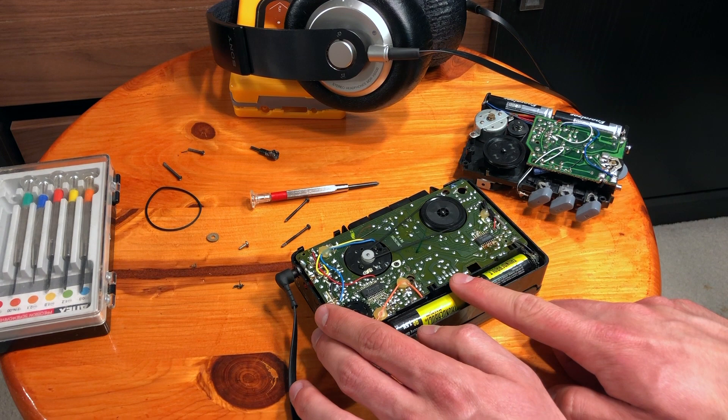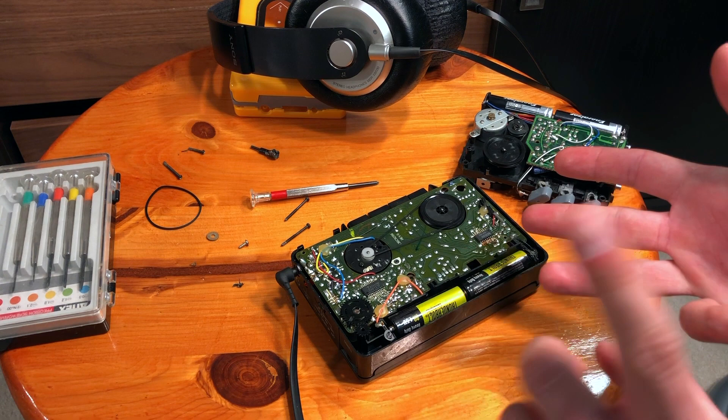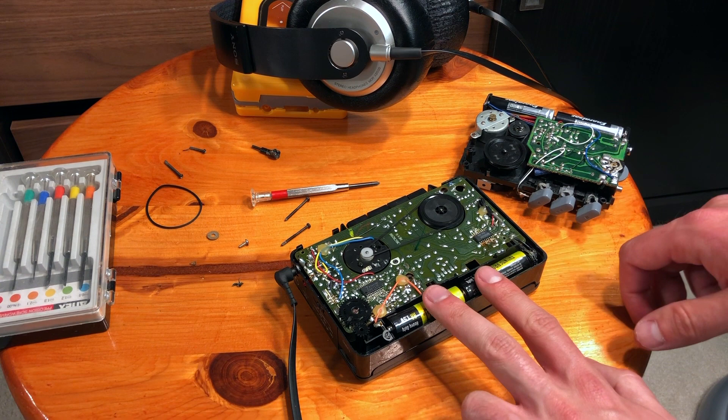Batteries are out of the question because I used the same battery before, so it wasn't the battery. Basically when the pitch is incorrect there are usually multiple things: first, something wrong with the rubber; second, the motor; third, the batteries dying. Rubber is easy to replace, batteries are easy to replace, but when the motor is dead, that's when things get complicated.